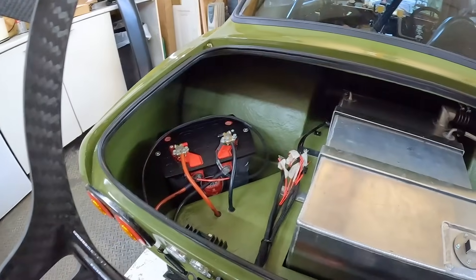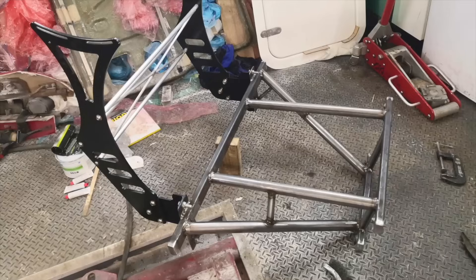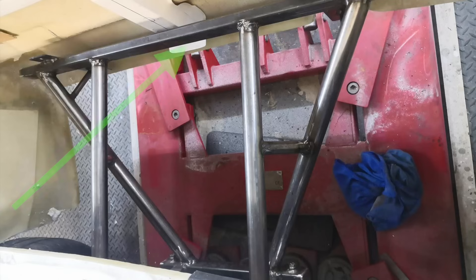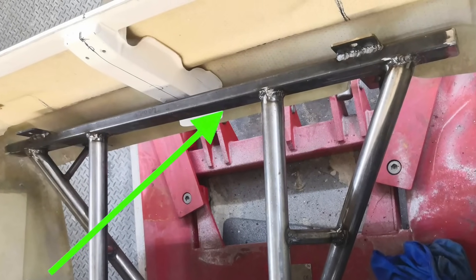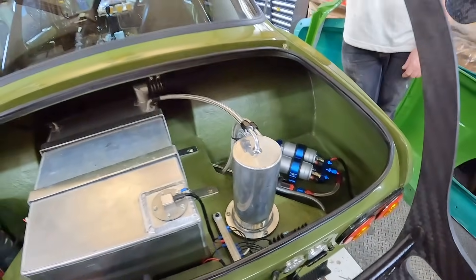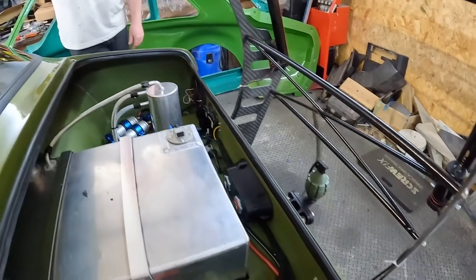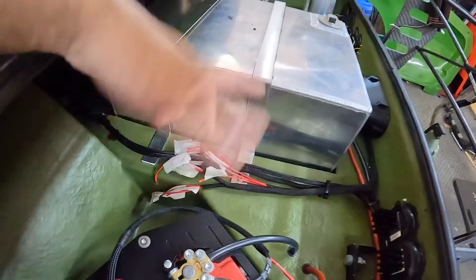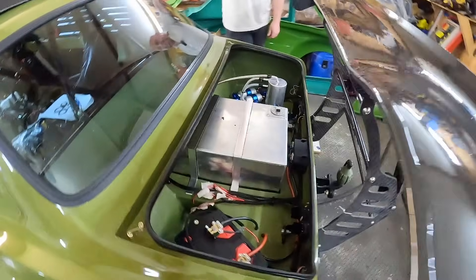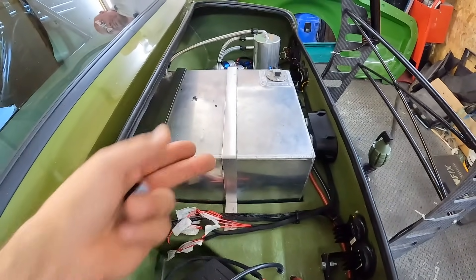The shapes in the boot are basically designed to fit around the chassis underneath. Gary made a square frame with 45-degree angle bars coming off it. It bolts to the rear chassis of the TVR and has a crash bar across the back as well, so if somebody hits the back end, the whole rear of the car won't just crumble. That's why there are these almost triangular voids - just following the shape of the frame underneath. You can see the wiring for the lights is already in, including the charging port - really neat, though it still needs to be hooked up to the loom. It's a proper neat custom boot build, and it's a 60-litre tank - 12 gallons, should be more than enough.